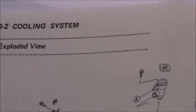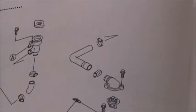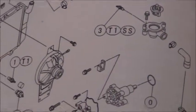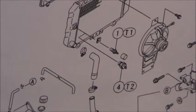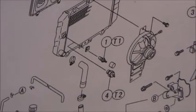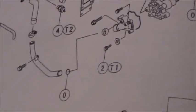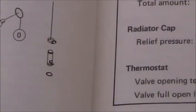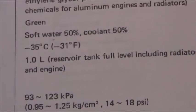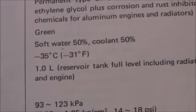Here in the maintenance manual there's the exploded view of the thermostat. That piece of tubing that comes out and makes a 90-degree turn to the right — that's the area the thermobob is plumbed into. Down across the engine, coming out of the radiator, that piece of tubing that makes a 90-degree turn and goes straight down is where the bypass line from the thermobob plumbs back into the cooling system — right into the water pump housing. Bill was asking about coolant volume: according to the book, I should get one liter total including the reserve tank, radiator, and engine. We'll see what comes out.